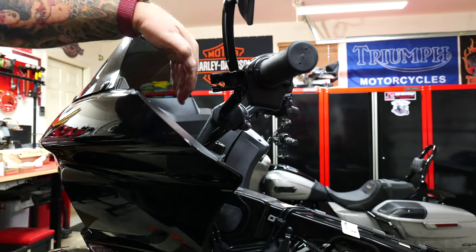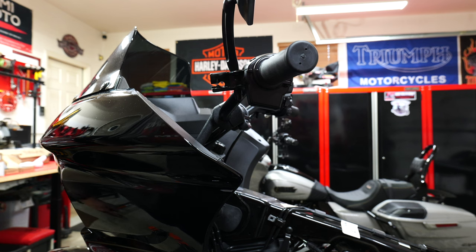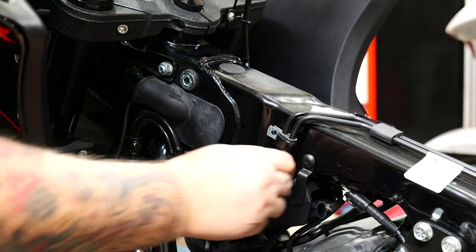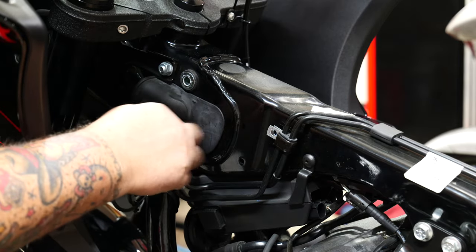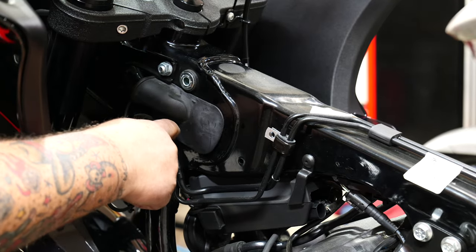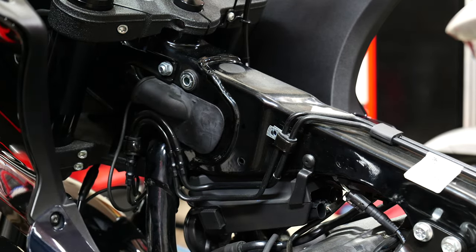Now that I've got the clutch cable disconnected, I'm going to move over and start working on the boot to get the different wires disconnected so we can free up the risers. Then from there we'll move on to the right-hand side and deal with the master cylinder. You can see here's where I moved the bolts for those cables because we've got to get to this boot. This boot right here is tucked in and lipped around the frame, and these bundles here make it a little hard when you try to get it back in.